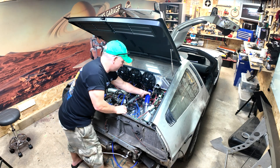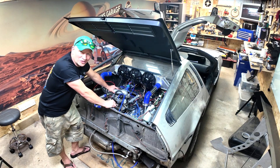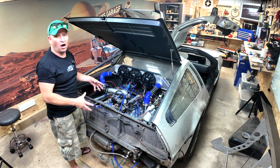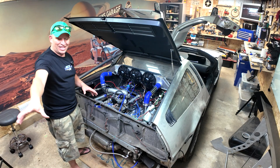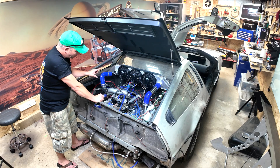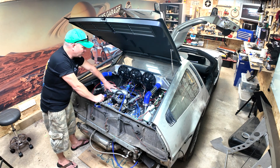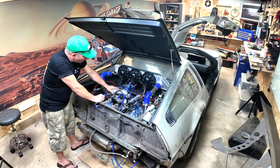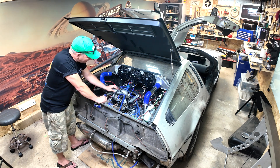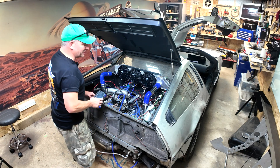These hoses have been pretty much ready to go on since I was first sorting out the engine about two years ago. One of the things I also want to put back on the car is the air conditioning unit — I can't show it right now as it's in a crate with the original engine — but it bolts down to the end of this rocker cover. I need to chop the casting back here to clear it; it's a load of heavy casting I don't actually need. That will let me bring the pipe from about here straight up to there, reducing the number of elbows and extra pipe. I'm going to take it back to about here, so we need to put it in the vice, take it to the hacksaw, disconnect all the pipes — and don't forget to take pictures to remember where everything goes.